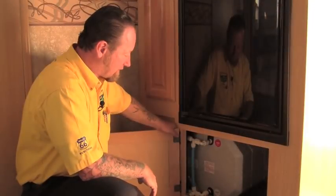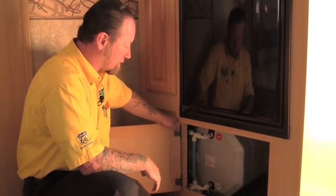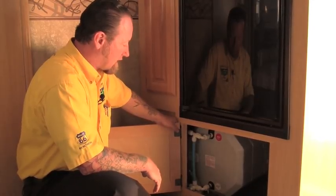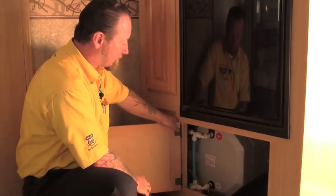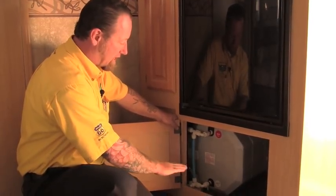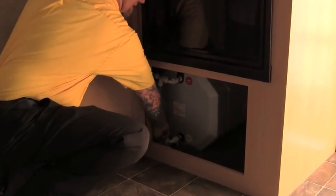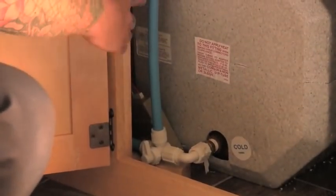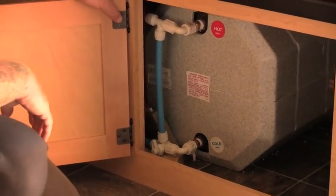In this particular unit we have the single-valve system, which we see in some newer product. They use a check valve on the top of the tank rather than the three-valve system. All we need to do is flip that valve from horizontal — the use position — to vertical. That way we're allowing the antifreeze to flow up the connecting pipe and into our hot water plumbing system.